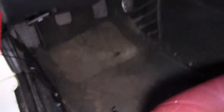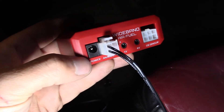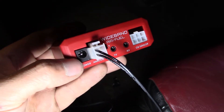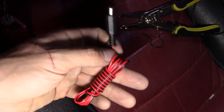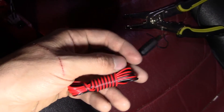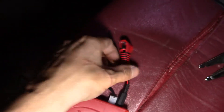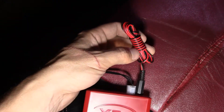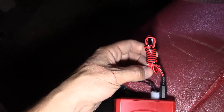The wire runs down to the control module. I've got to get power here where my thumb is. Here's the power adapter wire that they give you to tie into your negative and positive 12-volt power supply. This just plugs into the control module. Then this has to get run to a switched power supply from the ignition, which I already have wires run for from my old sensor, so I'm just going to tie those in.